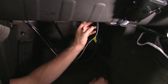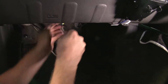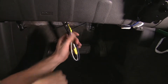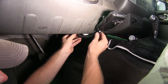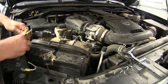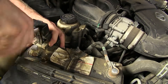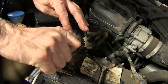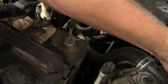We'll take a few moments to zip tie the wires inside, making sure they're safe and secure and don't interfere with the pedals. We'll use a small piece of loom material to help hide the color of the wires — electrical tape works too. Back under the hood, we'll hook up our wires. Starting with the positive side, we'll loosen the nut using a 12mm socket, put our two ring terminals on, and replace the nut. Then we'll go to the negative side of the battery and use a 10mm socket for that side.